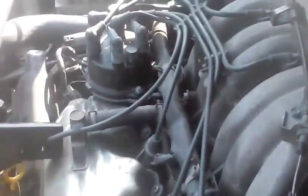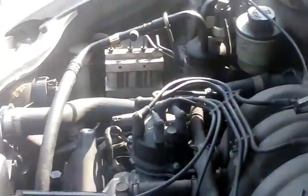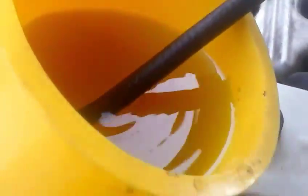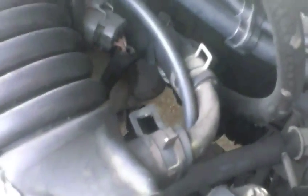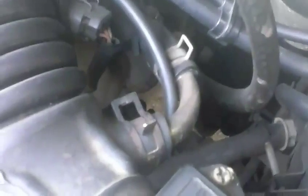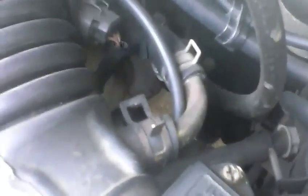This thing's really warmed up. I'm revving it up to 2,000, 2,500, and 3,000 RPM. I've seen an oil leak running — not sure which. It's not moving. That little hose there is going down to the heater. There's a little fitting to put a hose on in order to bleed air out of the heater core — you run this little hose off and immerse it into coolant. It blows bubbles up. I've seen maybe a couple, two or three little bubbles — that's about it.